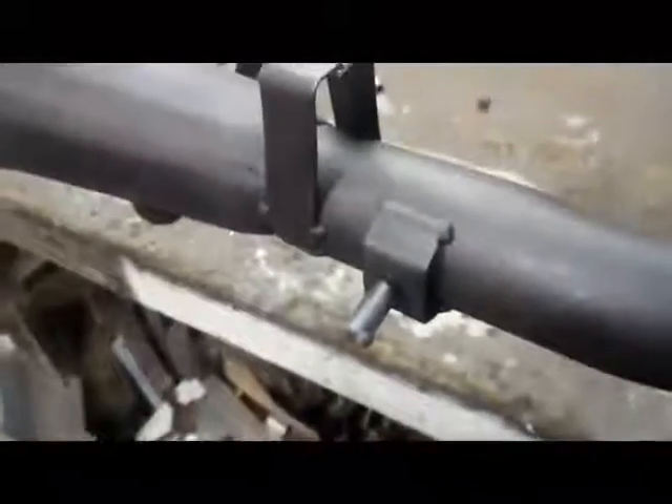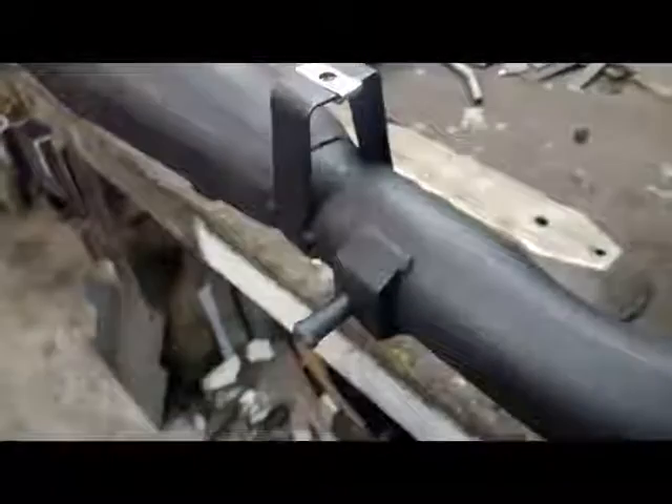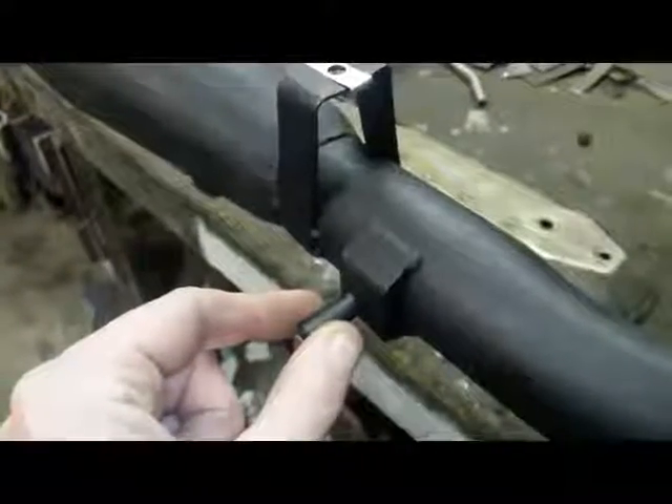The exhaust rubber is just a nice push-on over this and that goes back up into the center of the car where the gear shifter is. I made a slightly different bracket that bolts up under the car, up to where there's an exhaust hanger in the car. I've also bent in and welded a captive nut for the heat shield — the MK5 or MK4 heat shield just bolts on there, hopefully to prevent the car from burning the grass if parked at a show.